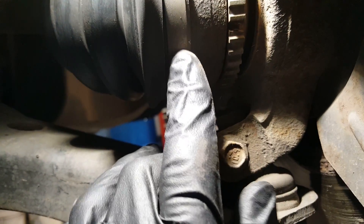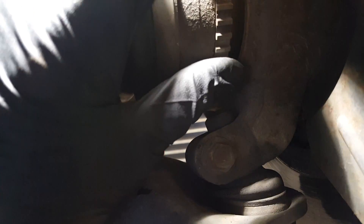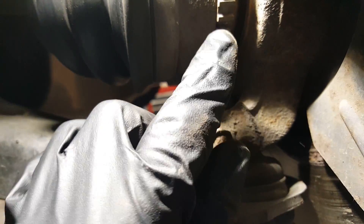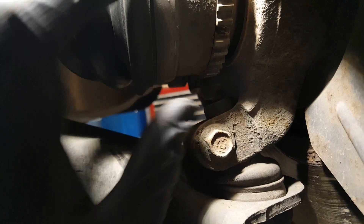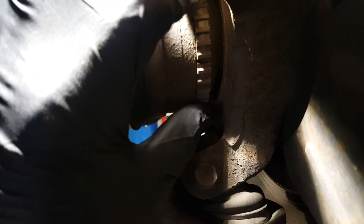So we've got three options: we can replace the drive axle that comes with a new tone ring, we can replace the tone ring itself, or I can simply try to fix this. What I'll do is clean this area up, get rid of the rust, pinch that together with a pair of vise grips, and weld it back on. I'm going to try to weld it and see if that works — if not, I'll put an axle on it.